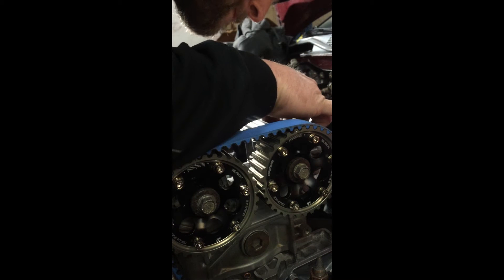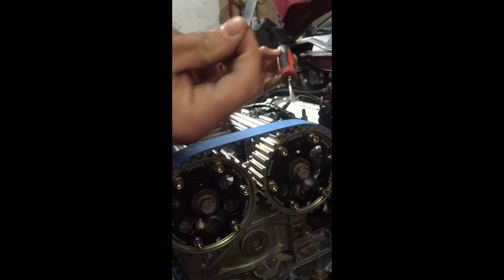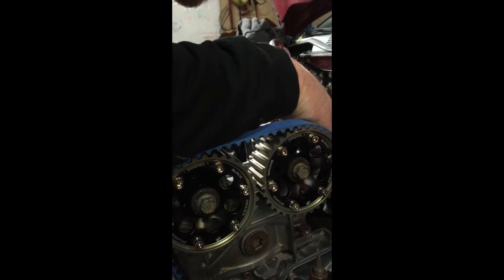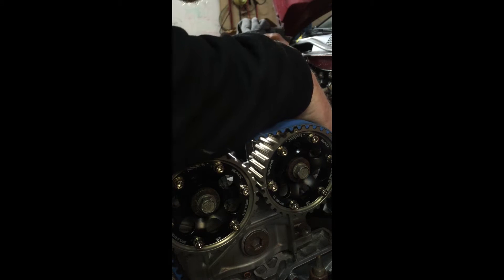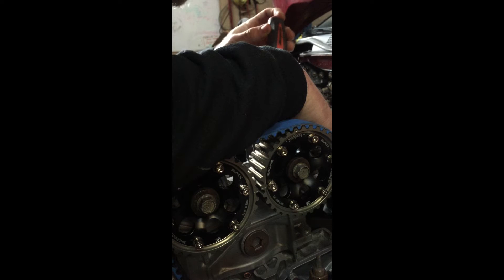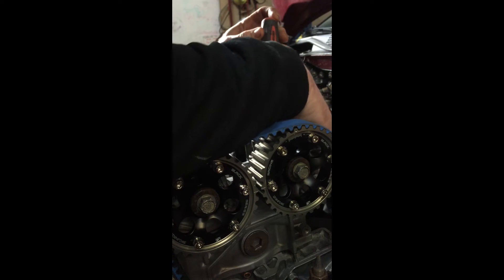Get in this nice little spot here. Right out of the box, it's tight. I've got my feeler gauges bent to 90 degrees to make it easier to get in. I'll usually spin the flathead until it stops and then turn it back maybe an eighth of a turn to where it's got a nice little drag to it.